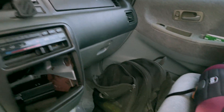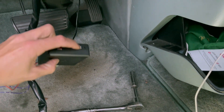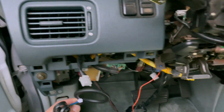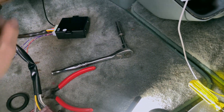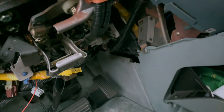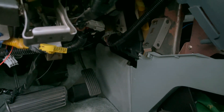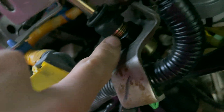Once that orange harness is plugged into the brake switch, you go all the way to the end and plug it into this box. For the antenna, you can find somewhere to mount it — I think I'm going to mount it at the bottom right there so it'll plug in right here on this side of the box. You can mount the antenna at the top of the clamshell, the bottom, or just anywhere where you feel safe, because you're gonna be scanning the ghost key on the antenna — it's an RFID. You're gonna have to scan it, then press the brake, then press the start, and then the car will turn on. This video is kind of all over the place — before I can install this antenna I'm gonna have to remove the ignition. Where you're gonna need to chisel is a tamper proof screw, meaning it doesn't have a head to it.